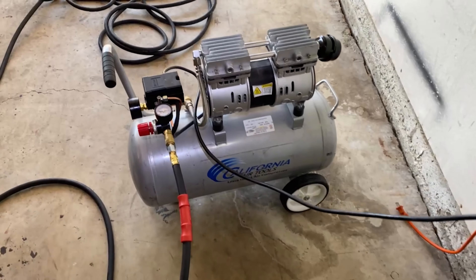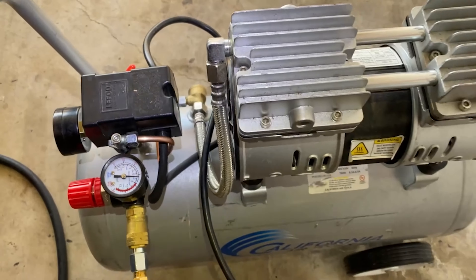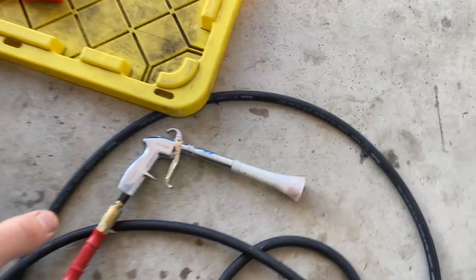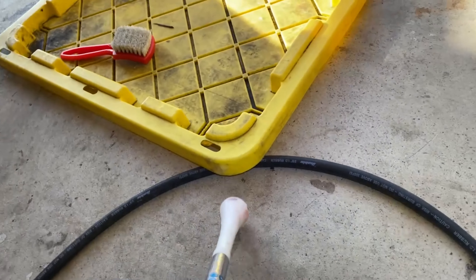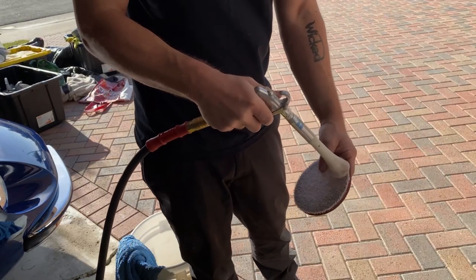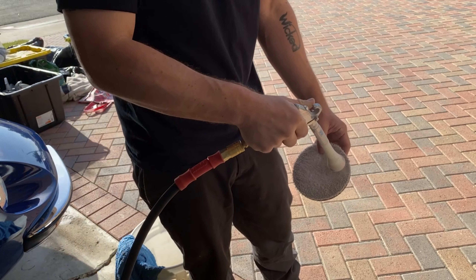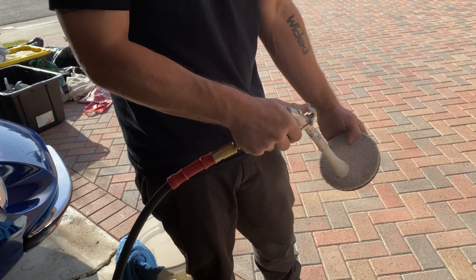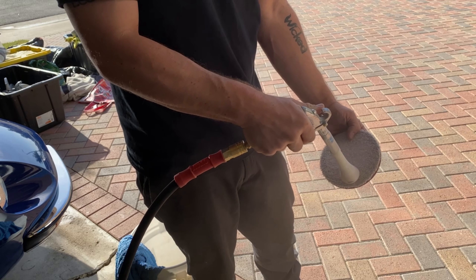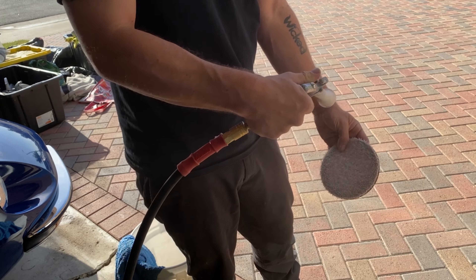For you mobile guys, this is an eight-gallon air compressor from California Air Tools — it's super quiet, you won't even know it's there. I carry this around with me to use my Tornador for cleaning pads and pulling stuff out. The Tornador gun is your best friend when cleaning pads — all you've got to do is spray the pad with a little liquid and then start blowing it out. This pad was washed in the washer with one of those Microfiber Restore products, and look how much dust is still coming out. Your washer and those products don't do anything — you need to blow pads out if you actually want them to be clean. This can take five or six minutes sometimes. This is the best way to clean pads.